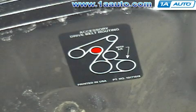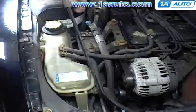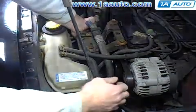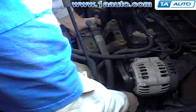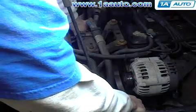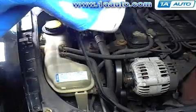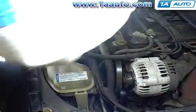And most importantly, what 2 shows you is the bolt that you'll have to connect a wrench to and pull clockwise on to loosen the serpentine belt. To remove the serpentine belt, I have a wrench on the belt tensioner and I'm pulling that wrench clockwise, and while I'm pulling up on that wrench, I'm reaching down and pulling the belt off the pulleys. Be careful as you're releasing the tension on the tensioner with the wrench, because the wrench could go back and pinch your hand in between something.